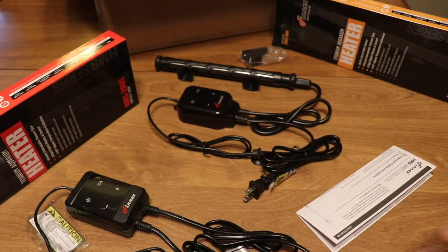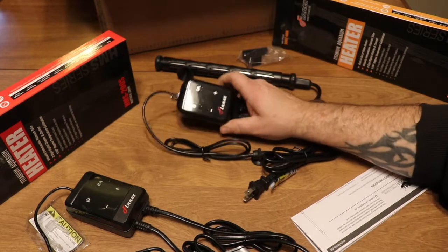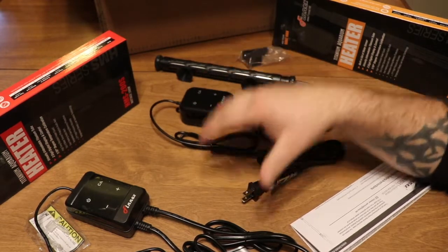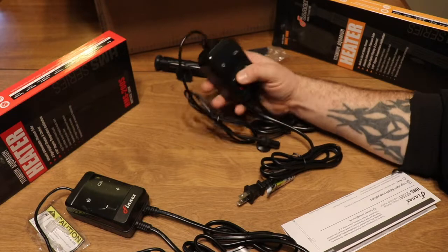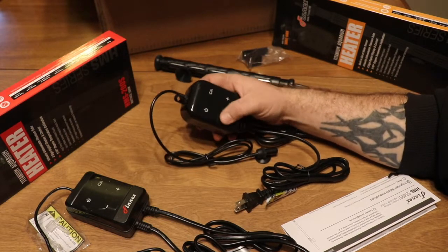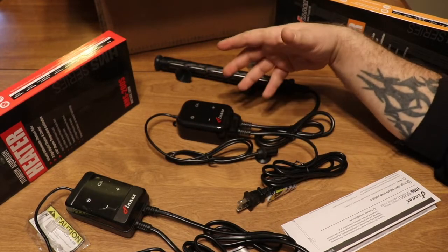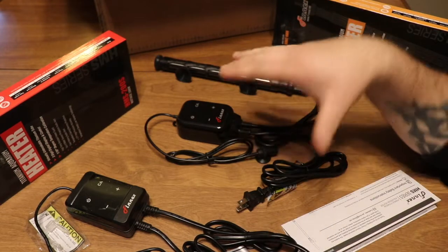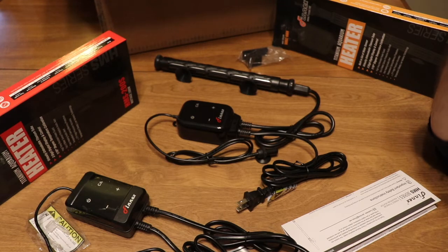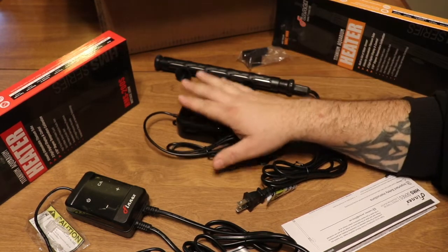Next, the most crucial thing that I am incredibly impressed with is the fact that you now have the ability to calibrate the probes. Now, the probes already come calibrated from factory. In the event that you want to calibrate it, you literally just hit CA, press it once, and then you decrease it or increase it. Now, the important part of that is making sure that you have a scientific thermometer. You don't want to just be using some random thermometer, like some digital readout thermometer that you've bought on eBay for 99 cents.